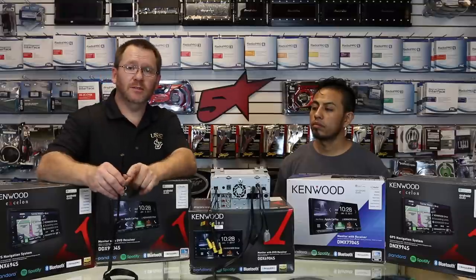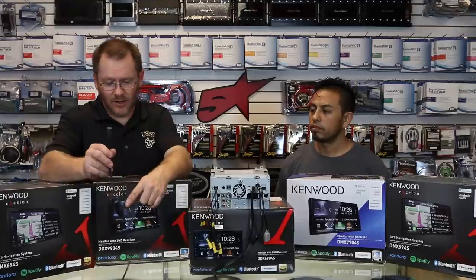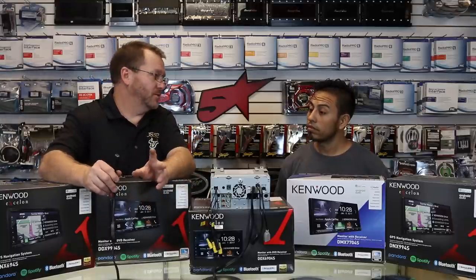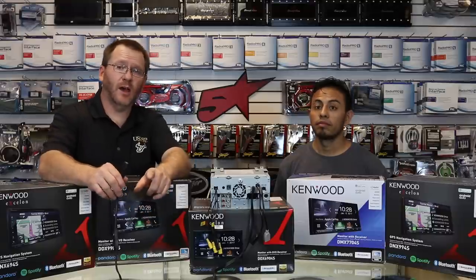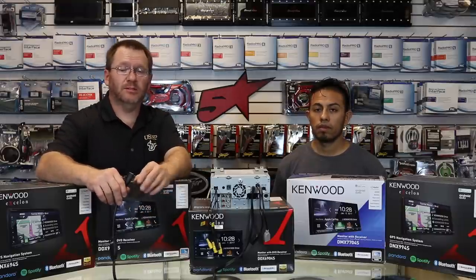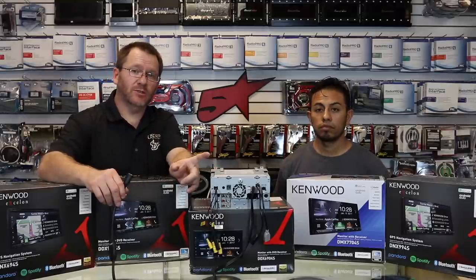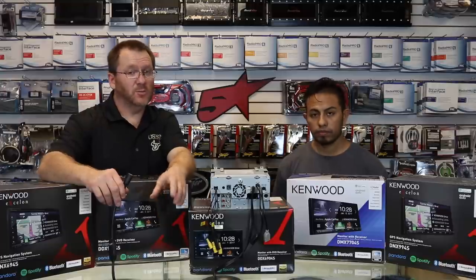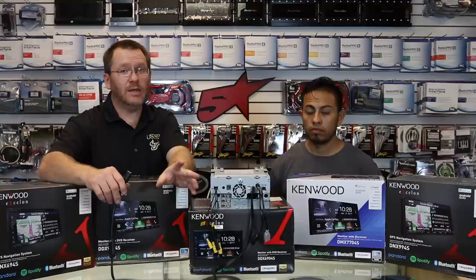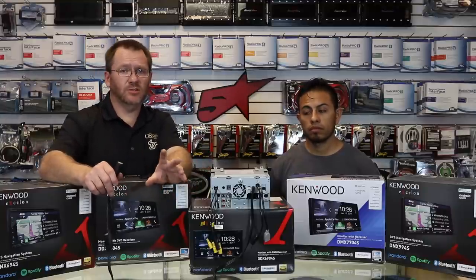Now you may be thinking: isn't HDMI just 1080? Yes — if I'm plugging an HDMI cable into an RCA jack, that can't possibly be 1080. And you'd be correct, it's not. The best that the iSimple Media Links will actually output is 720. However, your screen resolution is only 800 by 480, which means the HDMI input was really only giving you 480 output. We're actually inputting above what the radio was seeing before.